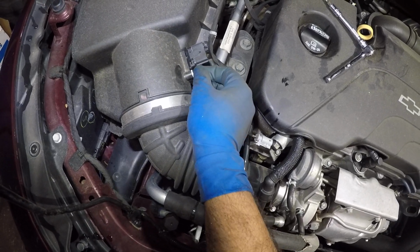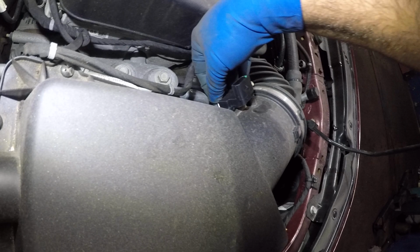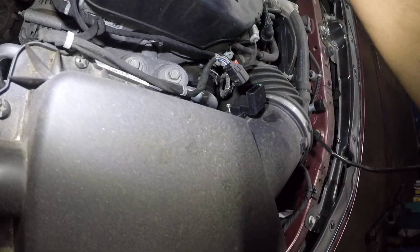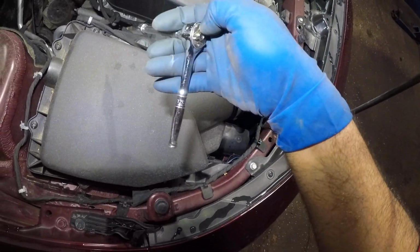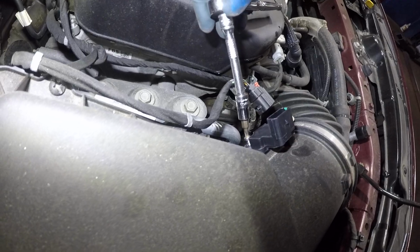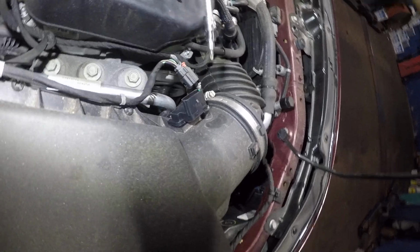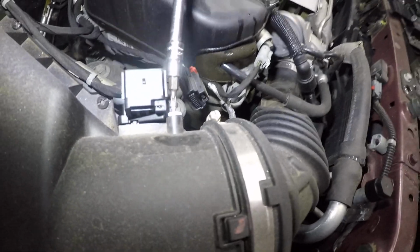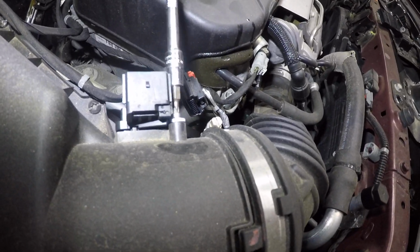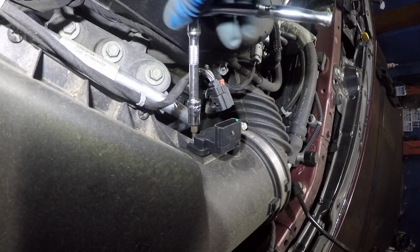We're gonna take this little guy. We're gonna grab our second screw. We're gonna get that guy right in there. And once we have both, what you wanna do is we're gonna tighten this evenly, okay? Let me just get my ratchet to go. And you don't wanna tighten one all the way. You wanna snug it, so just give a small snug. And a small snug, and another small snug.